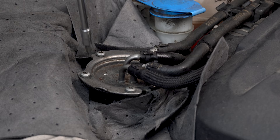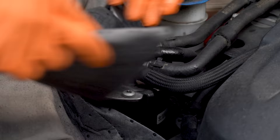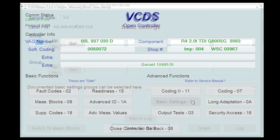You're gonna need a T30 to get the fuel filter lid off, probably a pocket screwdriver or flat blade screwdriver to open the lid up. I really like some oil absorbent mats to make sure we're not getting diesel fuel down in our engine compartment. Saturating your serpentine belt or any of these hoses with diesel fuel can lead to a bad day. And if you got it, go ahead and grab that scan tool.